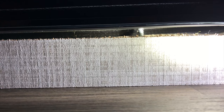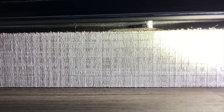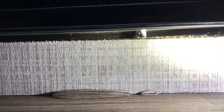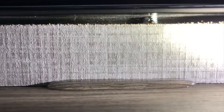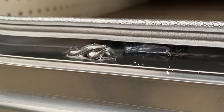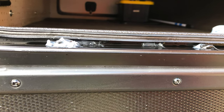While I was still in the cargo area, I decided to tape a close-up of the area where the leak occurred. This time, we were able to isolate the issue — as you can see from this intriguing piece of film, the water was coming from a screw, pooling on the aluminum door frame, and then emptying out onto the floor. The specific screw with the problem was one of four along the bottom of the slam-latch door frame that had factory silicone applied. Apparently, the screw wasn't fully covered with silicone and was allowing water to drain into the wall.